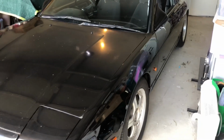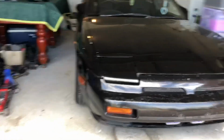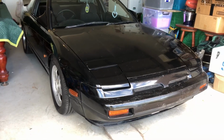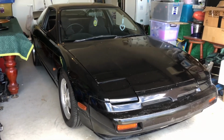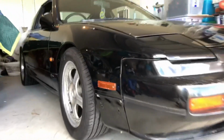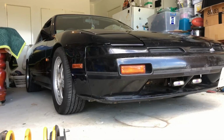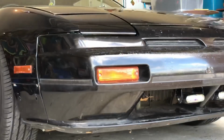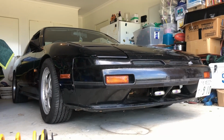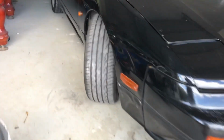Alright, so the coilovers are in. The car's much lower and has a lot more camber now. The front wheels are obviously sitting quite far in the guards, but tomorrow, as I said, I've got the extended lock control arms coming in, and they'll push out a fair bit. Yeah, that's pretty uncool, that's for sure. But otherwise, it's dropped a whole lot more and looking much better. Oh, there you go, yeah, looking much better. So it's sitting real nice.